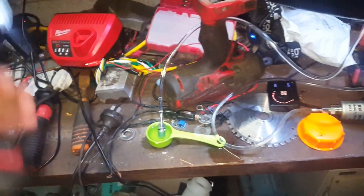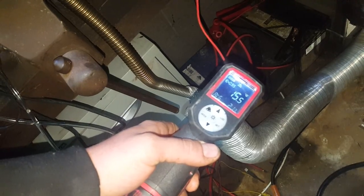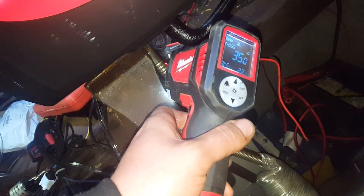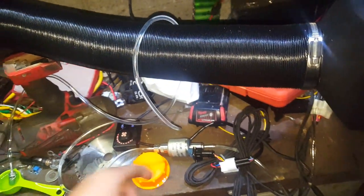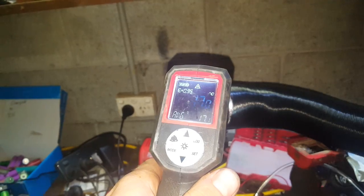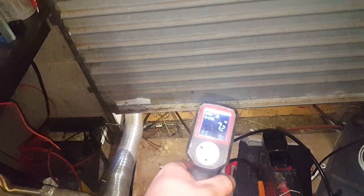Towards the end I might have to hold that up and stand it in there. We should be able to sense some temperature in the exhaust. As the diesel starts to burn that'll start to go up. You can hear the fan speed increasing at the same time as the diesel pump increasing. We're starting to get warm air — 16, 17 degrees air temp coming out of that there. About 10 in the middle because I have had the heater going; outside air is more like seven.